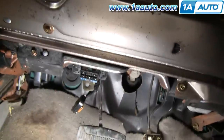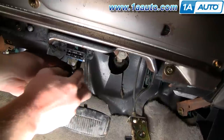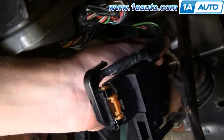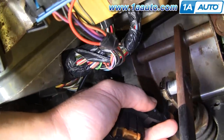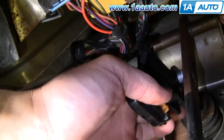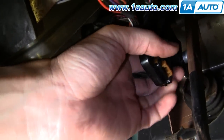We're going to move the camera and reinstall. Just plug your harness in and push the clip in to re-secure that harness. Back up underneath — feel up in there and move that brake master cylinder rod over just to the edge of that shaft. Make sure that bushing is still on there, then get the switch up on there. Push the switch up and then push it onto the shaft.